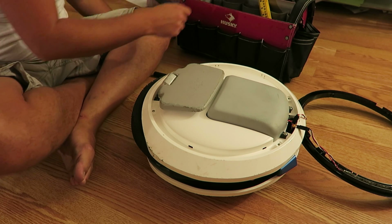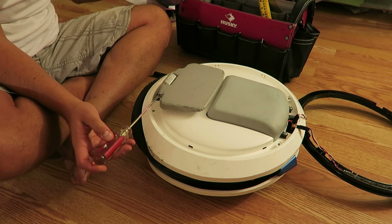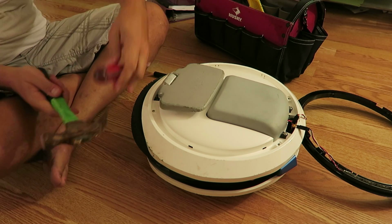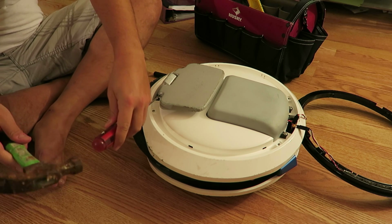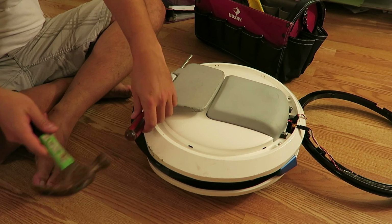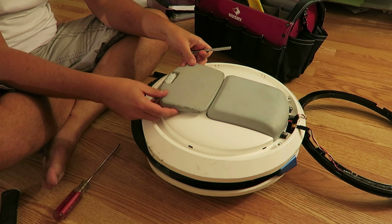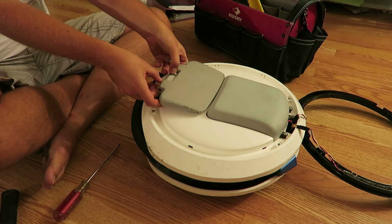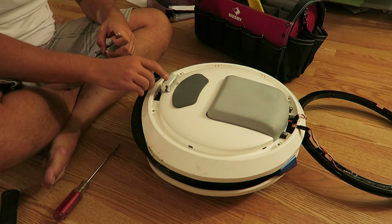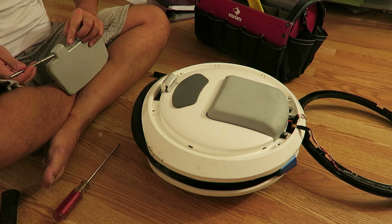We're gonna put this over here so we can remove the pin. That pin is held in by compression. I'm gonna use the same flathead screwdriver. You can use anything for that matter. I'm gonna put the flathead up against the pin and just gently love tap it out. Again, no need to swing like a monster here. That's the pin. And then there's gonna be two plastic bushings that go in between the pedal assembly and the pin itself, or the bracket. Because you don't want to lose any of this stuff, I'm just gonna put the pin back in.